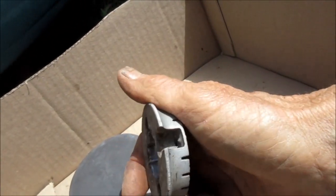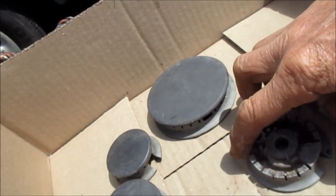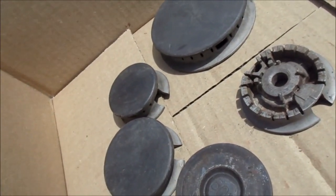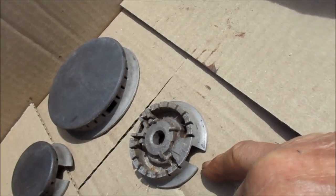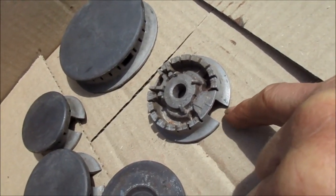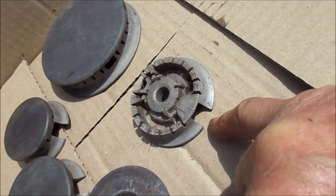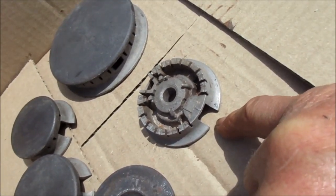first thing you want to do is check your electrode. It's normally underneath this on your oven. If it's cracked, then you've got a problem — you hear the spark, but it won't light. There's a little white thing normally on your stove, on the stovetop. It looks like the end of a spark plug. If that thing's broken, then you need to replace it.